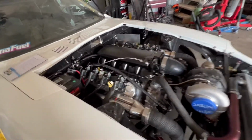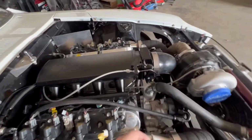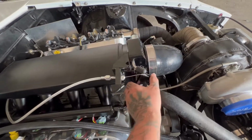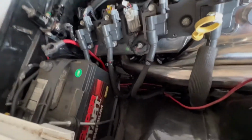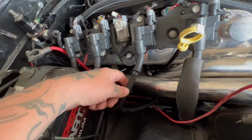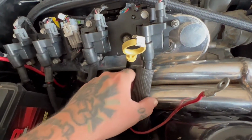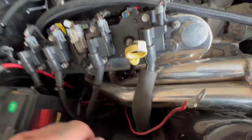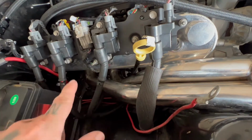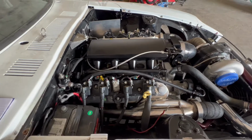It was real clean at the start, and then as it kept going, it just got more and more cluttered. Got the new throttle cable on, got it all set, so we've got full throttle, 100%. We wrapped all our spark plug wires with heat shielding so we don't burn them on the exhaust. I also put another boot on each side that was touching the exhaust to get it away and not be burnt. So yeah, like I said, the fuel fitting should be here today.